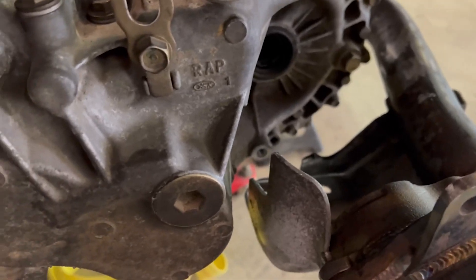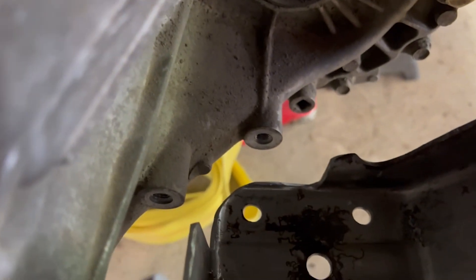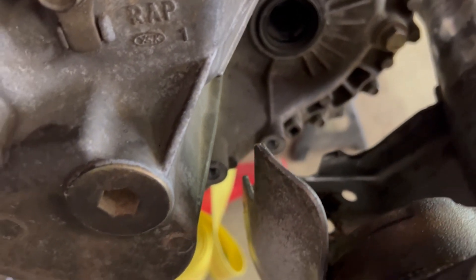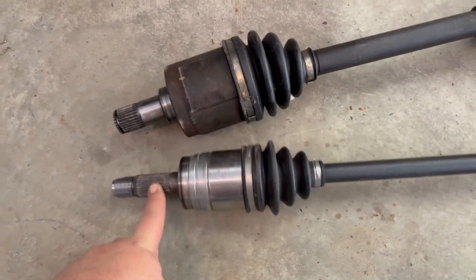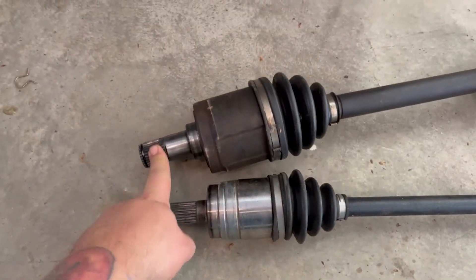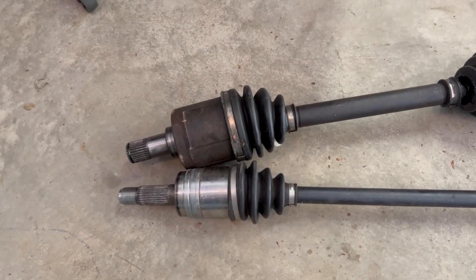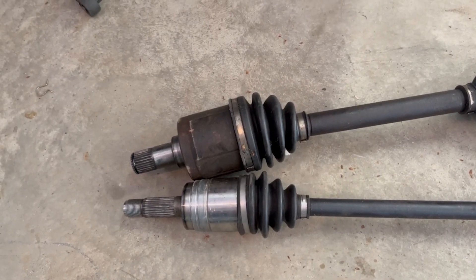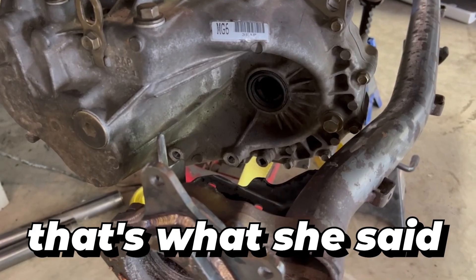We have our notch in the rear axle tube housing — it's cut to be able to move up and down and actually miss the transmission itself, so that's progress. This is going to be the outer portion of our axle — this is the CRV end, and then this is the K-series end that plugs into the transmission. We're going to cut these all up and see what's inside. Collectively, I've measured about eight inches of actual shaft to work with — that's going to be tricky.